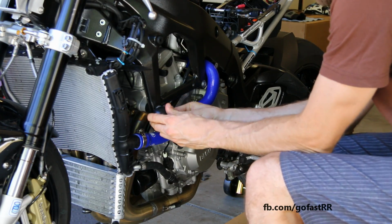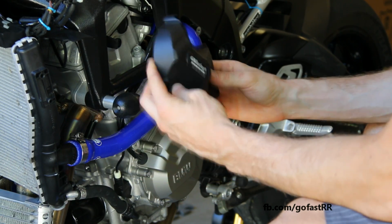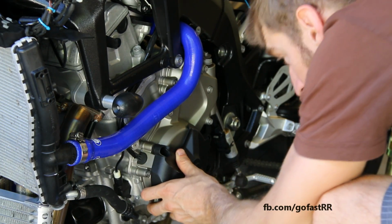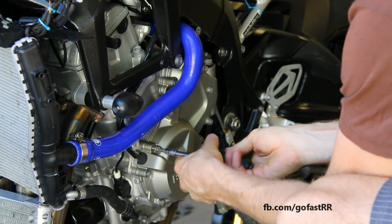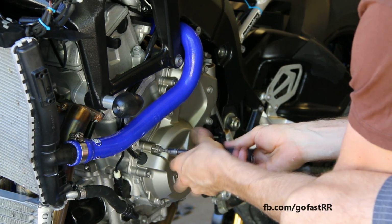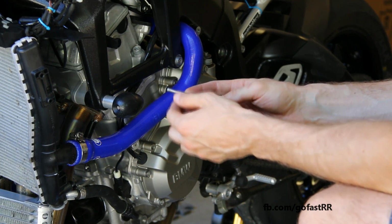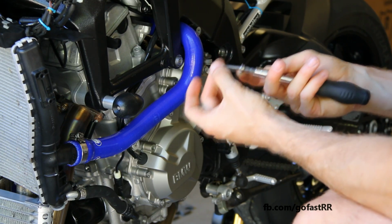Now I'm just putting on simple stuff, plastic, lightweight, GBRacing, real affordable. It's going to line up right like that, so we have to take out a couple bolts. All these bolts on the BMW are aluminum, right? Stock. BMW will say you cannot reuse these in their manual. It's like you have to buy new ones every time, right? Because it's going to stretch them, it's aluminum.